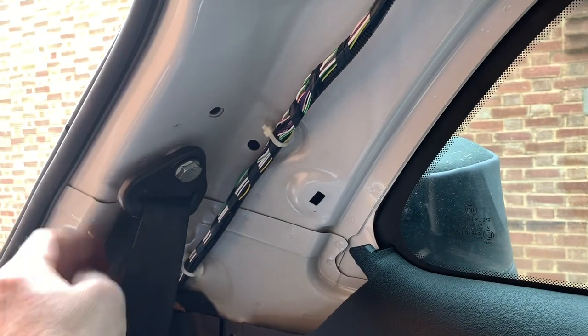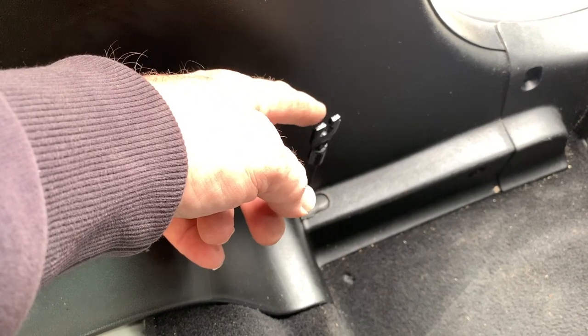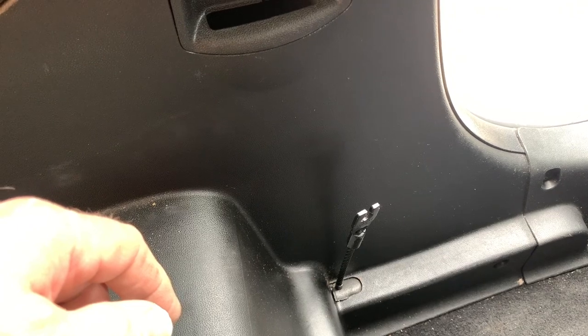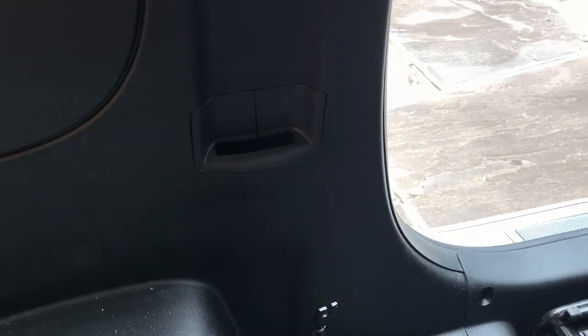There's the wiring loom going to the boot. Before I do any more, I'm going to disconnect the battery. The seat belts do have pyrotechnics in them. These ones I don't think have gone because the cable hasn't pulled in, but according to the ECU scan the resistance is gone, so they do need replacing even though they haven't pulled through. Before you start fiddling around with seat belts or airbags, you need to disconnect the earth terminal of the battery. You don't need to take the battery out or disconnect the live terminal - just taking the earth quick release off is enough.